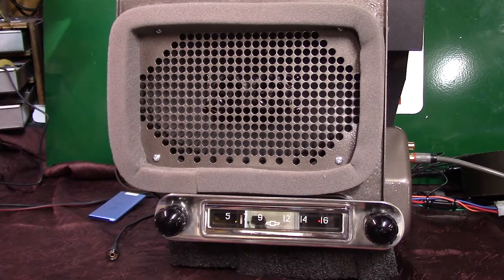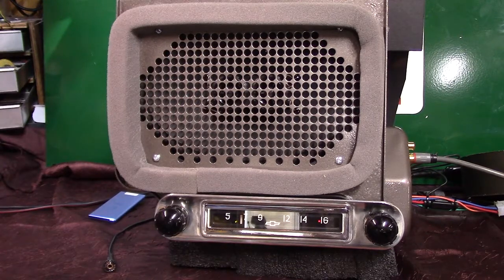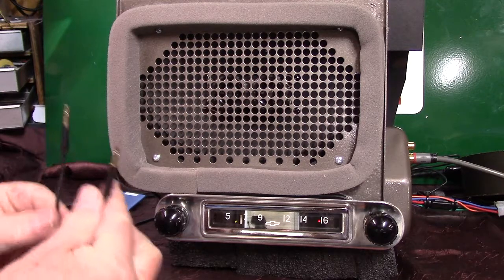You've got two more channels you can use somewhere else. You've got a right and left pre-out for a sub, and the right and left pre-out for a set of rear speakers if you want to put bigger amps in. And it's got an auxiliary in, which is automatic — it's your cable here.